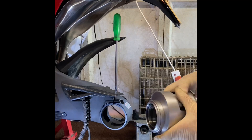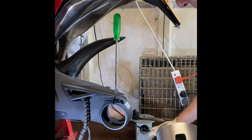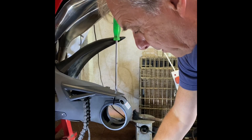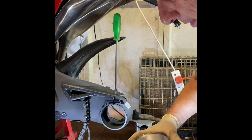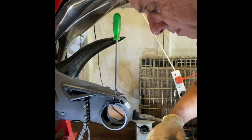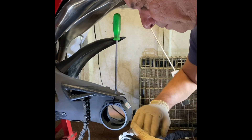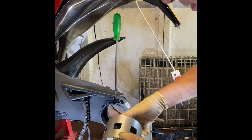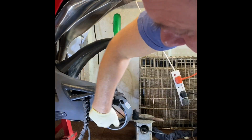This is the 2010 hub that I'm going to install. I've had all the spacers out, flushed and greased using lithium high performance bearing grease as per the spec. I'm just going to put a little bit of grease around all the edges that come into contact with the swinging arm. It's also important to make sure you put grease on the edge where the caliper flange goes as well, so you've got nice good contact there. I'm going to do a little bit of a smooth round here as well.